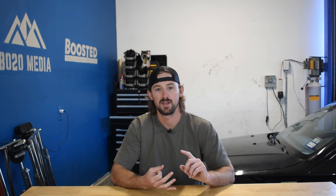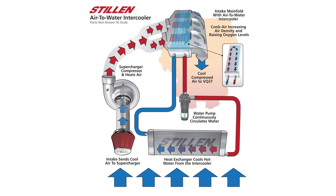If you're looking for fueling upgrades without needing to upgrade your high-pressure fuel pump or injectors, you can look at using water methanol injection, which is a great route to get additional horsepower and fueling. Another modification is an upgraded charge pipe — the factory charge pipes on any BMW are known to crack at some point, so upgrading the charge pipe is a good bet. You can also upgrade to a charge pipe that supports water methanol injection. On the cooling side, the B48 uses an air-to-water intercooler, so intercooler upgrades aren't really a thing, but it does have a heat exchanger that can be upgraded. You don't need to upgrade the heat exchanger for basic bolt-on modifications, but if you're trying to maximize cooling and reliability, it only runs about $400 to $500.